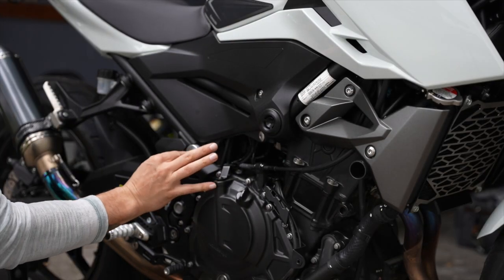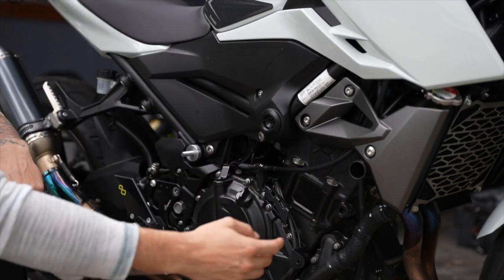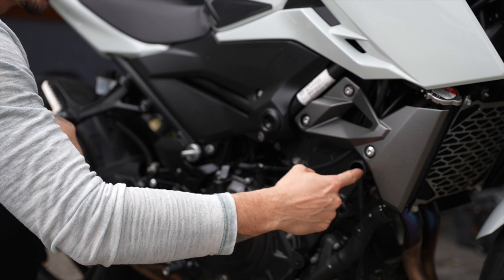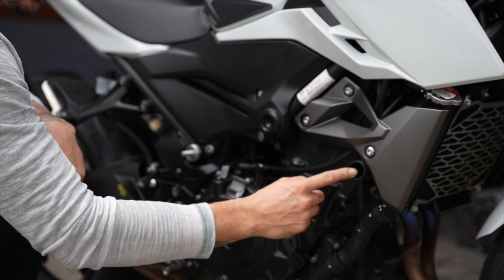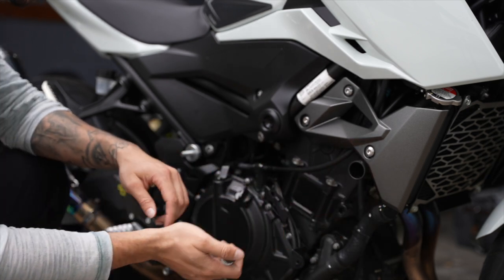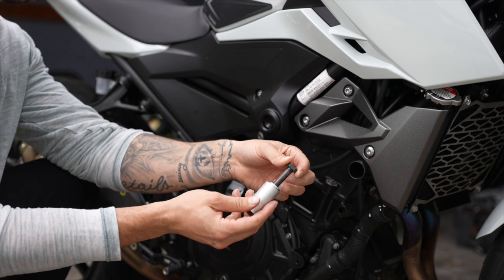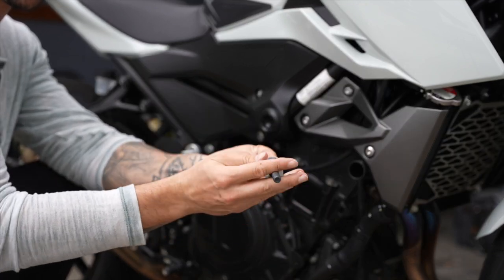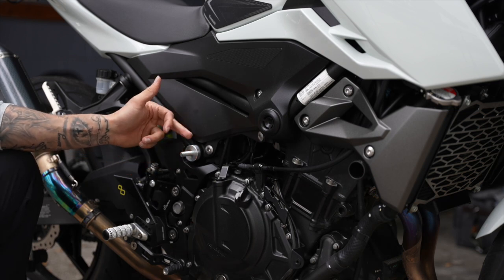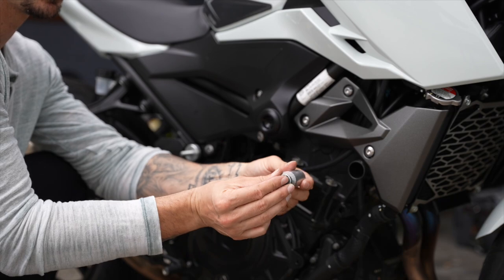We're back on the brake side. We don't want to cut off our ability to access this bolt. This is the part of the frame connected to the engine — just like back here, it's supporting the engine. We're gonna remove this bolt and then put that right-side cage on. I don't know if it's gonna be the shorter or the longer version, but just like here, we've got the crush washer and then we put the bolt on. If you forget, just remember: spacer, crush washer, hex bolt — on both sides.